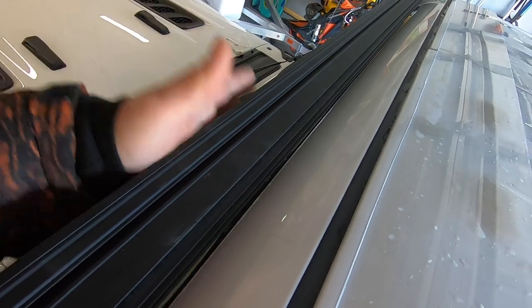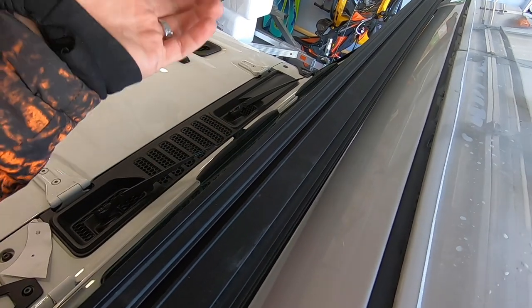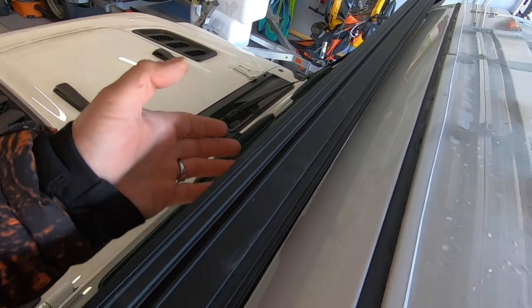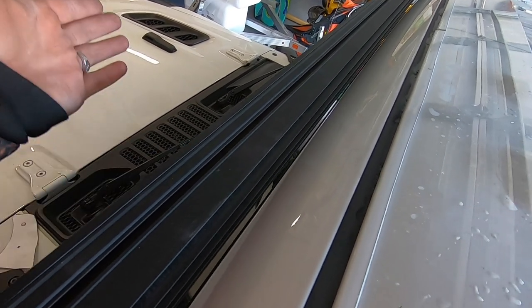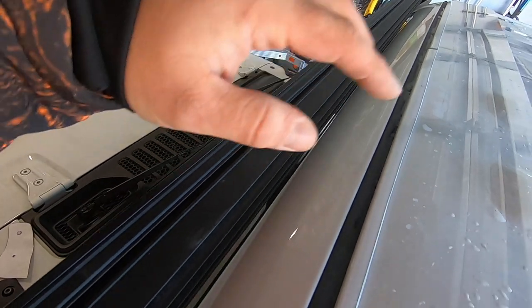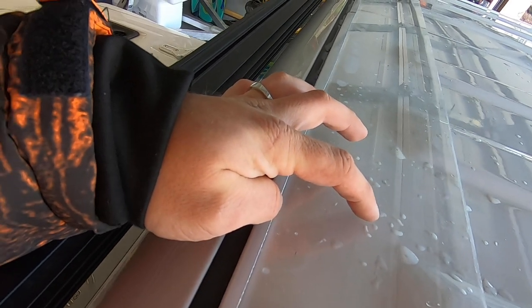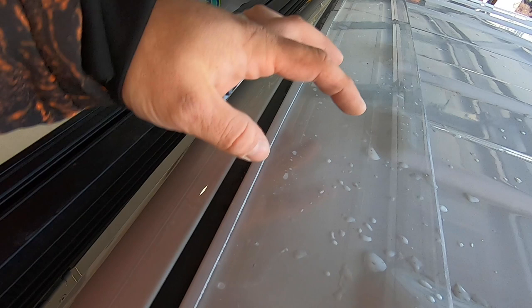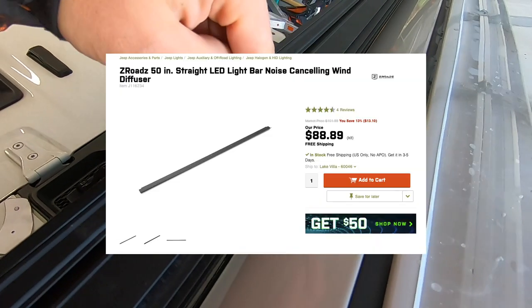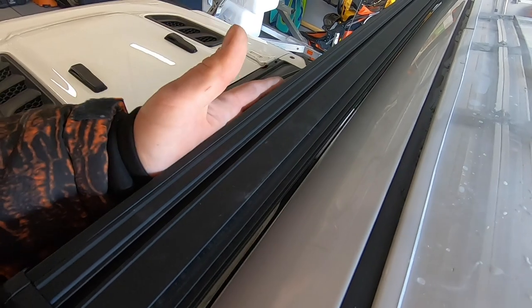The best solution is to redrill and move the light bar in as close as possible — I did the same thing on my F-250 and it significantly lowers the wind noise. At 80 miles an hour now it sounds the same as going 25–30 miles an hour with the light bar sticking out before. There are also little aluminum inserts you can buy — I think Aerolids or similar — a 50-inch piece that you rivet through the fins for about a hundred bucks. Save yourself that money and just move the light bar in.